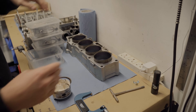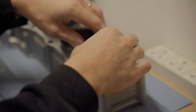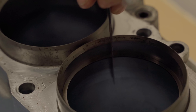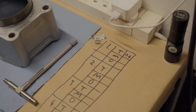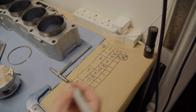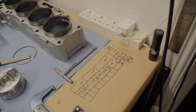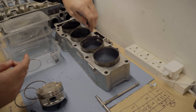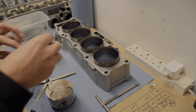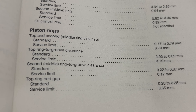A set of rings is about £55 each, so I really wanted to check the condition of these before committing to buying new ones. I measured their end gaps by placing them in the bottom of the cylinder about 10mm in, then pushed them in square with a piston and used a feeler gauge to check the gap. The top and middle rings have different clearances, so I needed to make sure I knew exactly which one I was measuring - they have different profiles, though I still managed to get them mixed up. I repeated the same for the oil control rings and moved on through the rest of the cylinders. These were all well below the service limit and had no damage on them, so there may be some life in them yet.